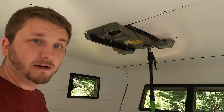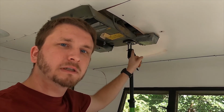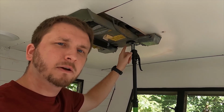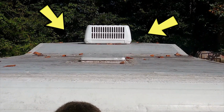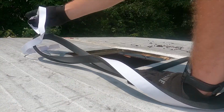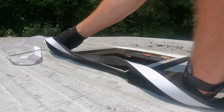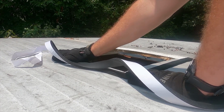We're in the middle of our final trim out, and we've had a lot of storms and found some water issues and discoloration up here on the air conditioner. So then we're like, what the heck? Why does it have such a problem? Well, that air conditioner weighs a lot, and the roof up here dips in a little bit towards the AC and allows all the storm water to sit there. It bypasses our water seal, because water against a water seal for long enough will eventually get through and drip inside.